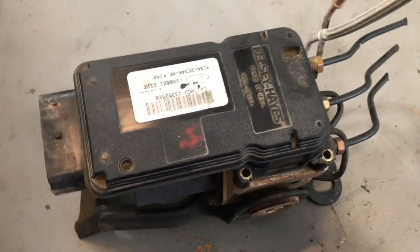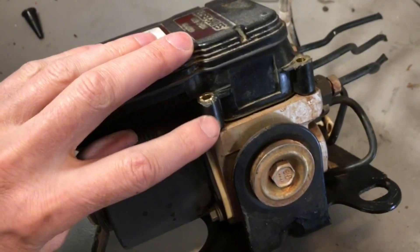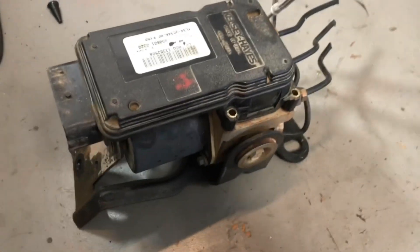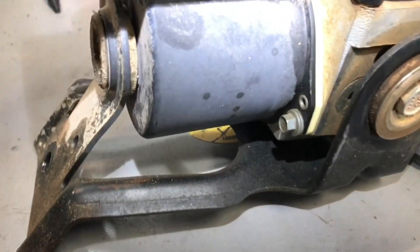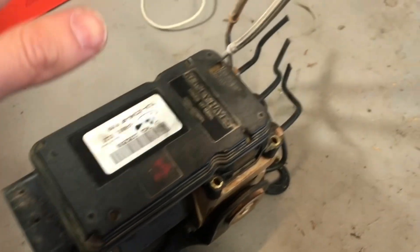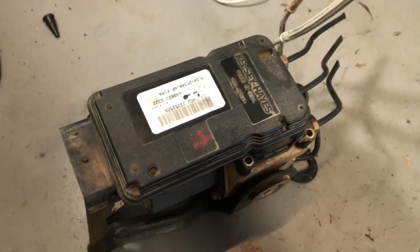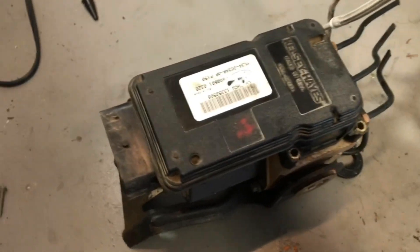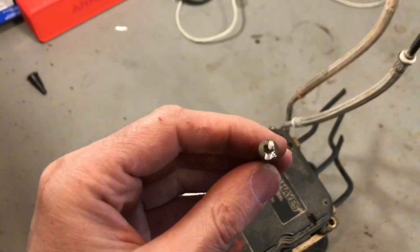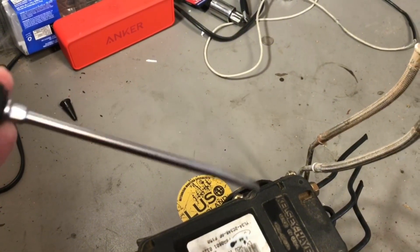They are T15 Torx heads. There's just four of them. They go through the plastic module and they thread down into the aluminum. There's just not enough to grab onto on a T15 Torx, and they get all seized up in there — it just makes it a nightmare and you end up stripping them out. All four on the donor unit I couldn't get out, even in Arizona where we don't have a big rust problem. And all four of the unit in the truck I couldn't get out either — they were all stripping. I tried different T15 bits, new ones as well, and they're just stripping out. So what I did on the donor unit on the workbench was take my angle grinder and cut slots in the bolt head, and that allowed me to get a big slotted screwdriver on there to break them free.